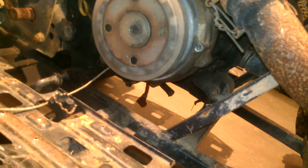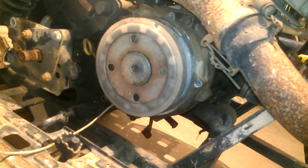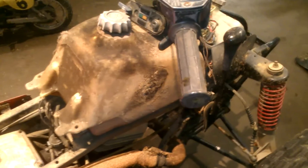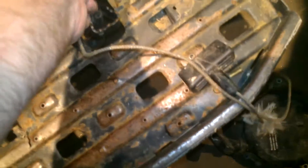I haven't gotten underneath it or anything. From what I've seen, the plan is: replace the pull starter, get the brakes straight, maybe get a new starter for underneath, figure out what the leak is, and see if the thing runs. It's kind of late at night so I didn't even try to start it. He said he's been wrapping a rope around and pulling it. I did it a second ago and it didn't do anything. I looked in the gas tank and saw a leaf floating in there, so the gas tank needs to be cleaned out.